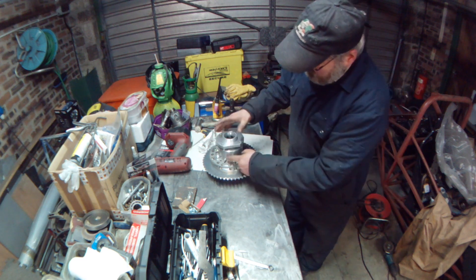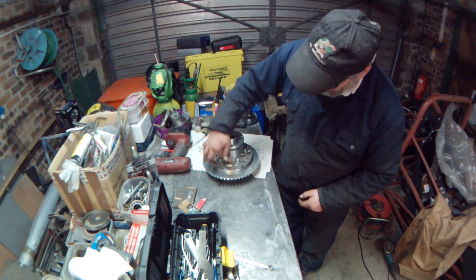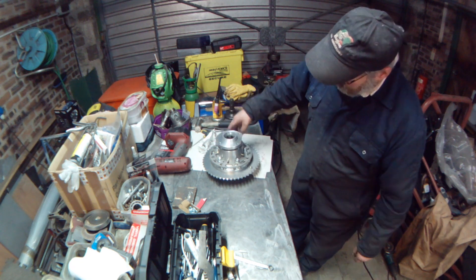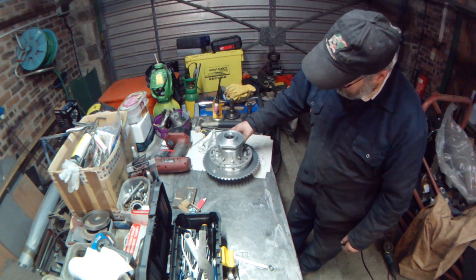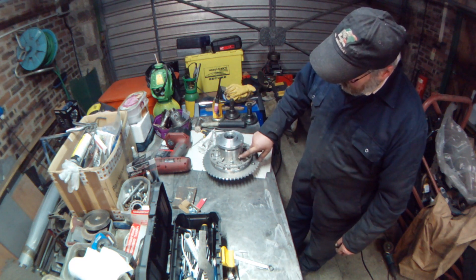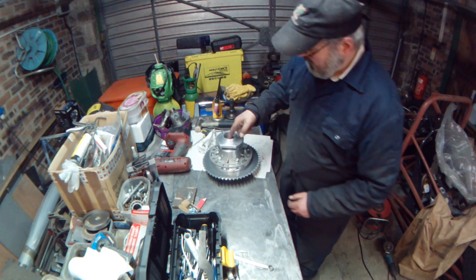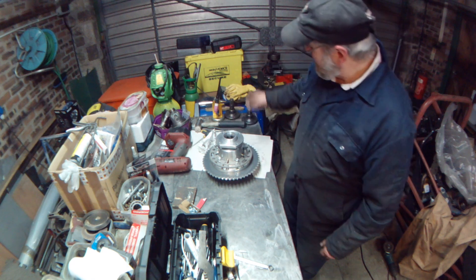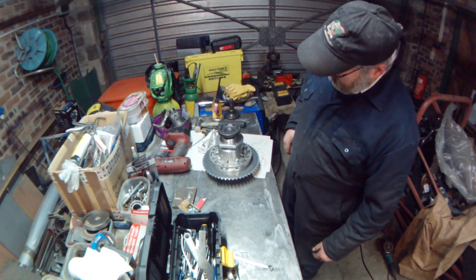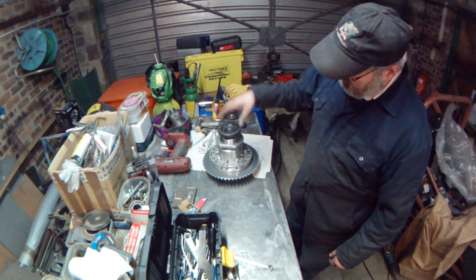The differential is lubricated with grease. It's got five grease nipples, one for each of the cross barrels on the ATB type differential. I pre-greased them before assembly and then you can pump in more grease as required. There will be oil seals on these output shafts that will run on this journal here - it stops any dirt going in and there shouldn't be much grease trying to get back out.